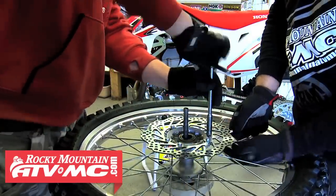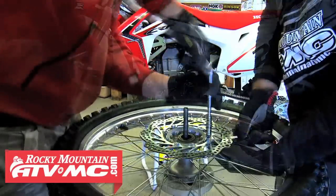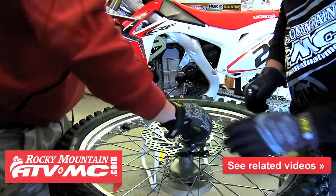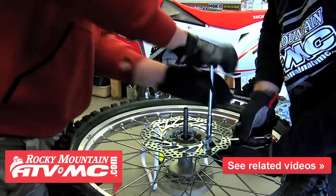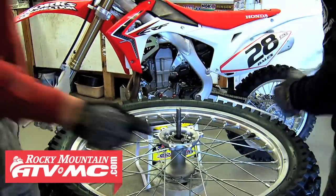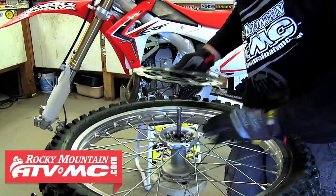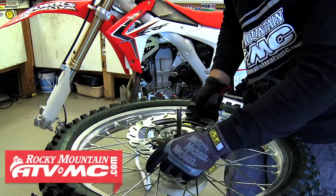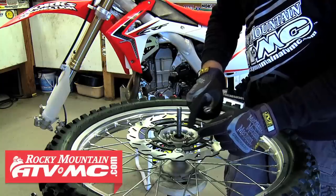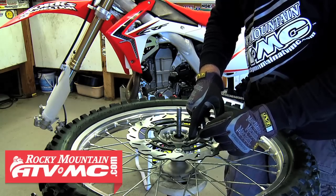We're going to remove the stock rotor. It's a little easier with two guys if you have it — if you don't have any friends, just do it by yourself. Have your buddy swing the T-handle while you grab the nut. Motocross is kind of an individualistic sport so sometimes you don't have friends — then have your wife come out and hold it. Make sure our surfaces are all clean with no damage, then simply line up our holes and reinstall the nuts — stock bolts and nuts. No need for thread locker with the locking nuts. Check your owner's manual for proper torque specs and tighten up.